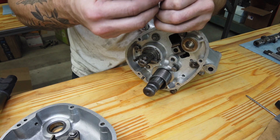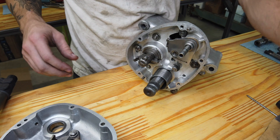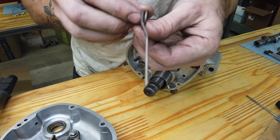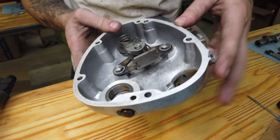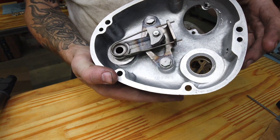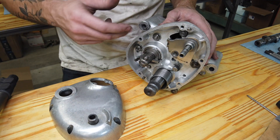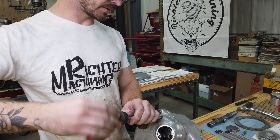Our kit came with a new O-ring for the ratchet plate, so dig the old one off. Install the ratchet plate into the inner cover, then fit the new spring — one end is bent straight and the other has a dog-leg to it, so you want that dog-leg to face downward. Stretch it over; there are little grooves in this that hold your engagement pawl. Once that's on, make sure your surface is nice and clean. I just realized I forgot to record the part where there's a nut that goes on the main shaft that sits behind this — make sure you get that on there. Well, that was a very poor excuse for a video on putting together an AMC gearbox.